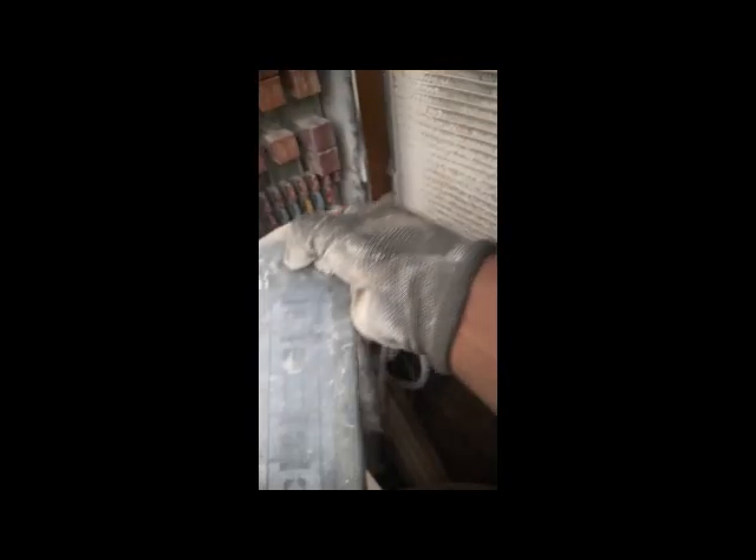Here's our fuse box, but you can see that the fuse box is also not showing good conditions — we can't recognize the fuses. That's why I was saying we use the hit and trial rule. I'm going to move this cover. I have removed the cover and you can see we can't read it very well, it's very difficult. So by hit and trial I just check all the fuses and check which fuses have problems.